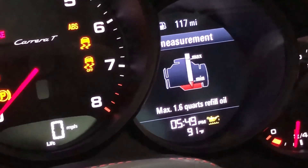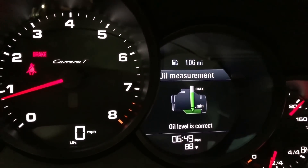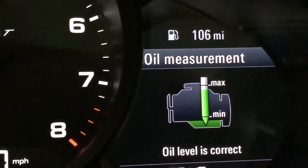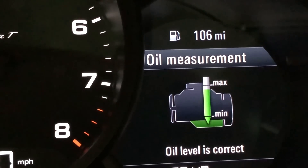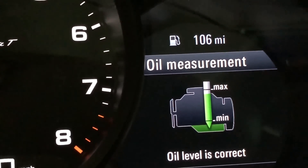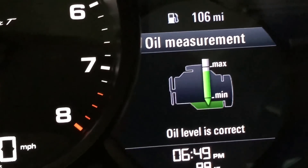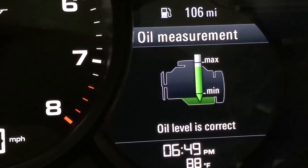At this point I had already lowered the car and it still shows that I need at least one more quart, so I'm adding that right now. After adding a little more oil I'm already at over 9.1 to 9.2 quarts and still not all the way to the top. This is surprising since pretty much everywhere I've read says a full oil change with filter should take about eight quarts. I think the difference is that I had the car lifted on the back with a ramp, so it was not level — that would have helped considerably to flush out the oil pan.